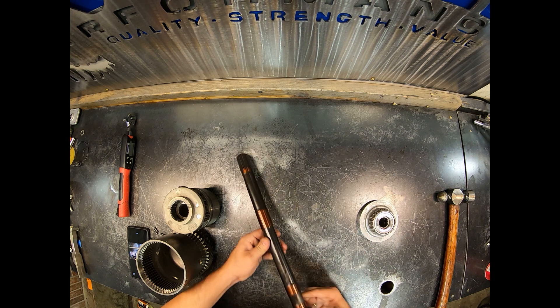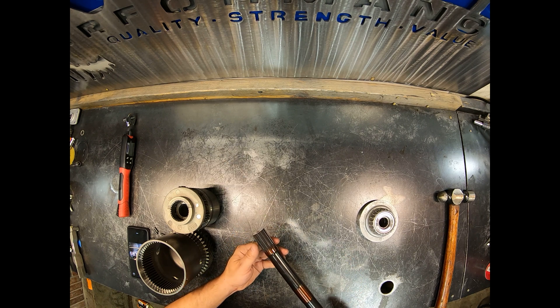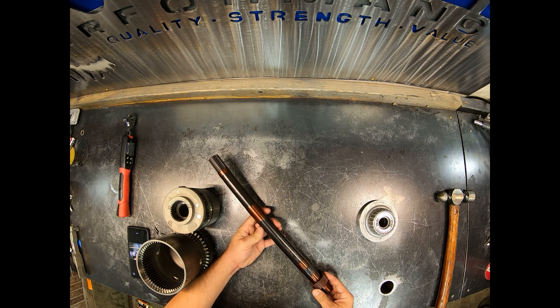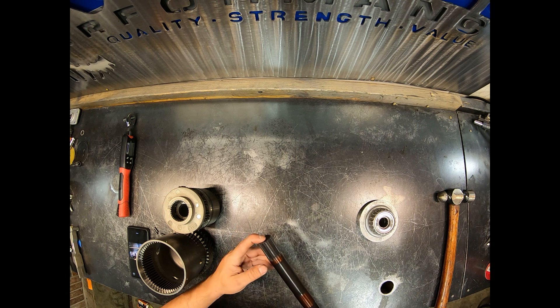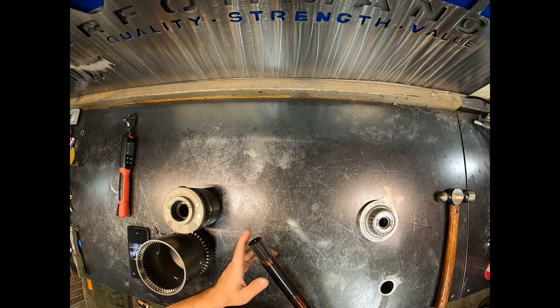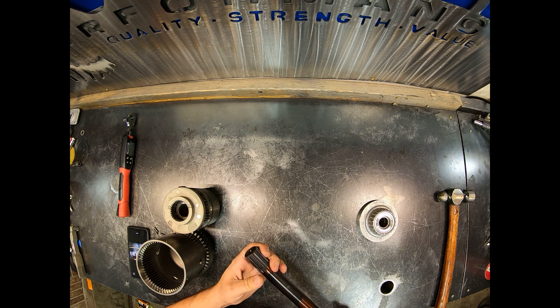The final part to your center differential is probably a part most people have heard of — this is the output shaft. This is a 25-spline, which refers to the splines on this end. This is also a 300M unit coated with an anti-corrosive — many times stronger than stock, great for drag racing or high-performance use, far superior to an OEM unit. It is critical that you keep these splines greased, and that your transfer case spool splines are also in good shape, or you will immediately wear this out. A lot of customers get their transfer case and transmission rebuilt at the same time so input and output splines are in great shape.